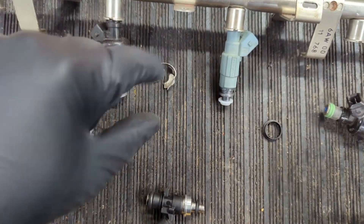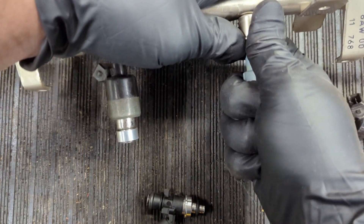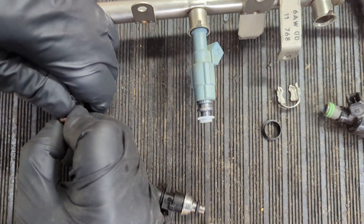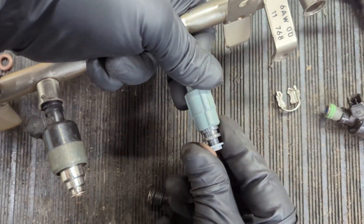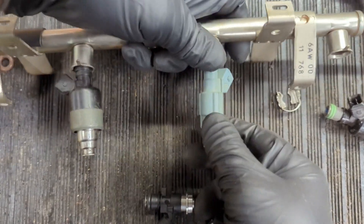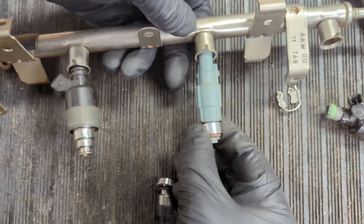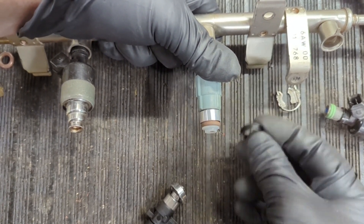The adapters stop the injector from falling into the manifold so you get the same results as using a clip. Without the adapter, because you can't attach the clip onto this type of injector, the injector can slide further down under pressure and lose the o-ring seal. When you put the spacer inside, it stops it from falling deep into the manifold and losing the seal.